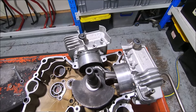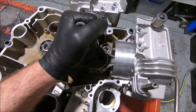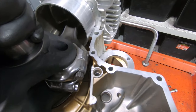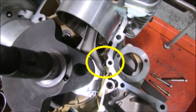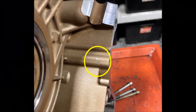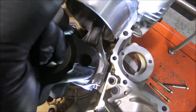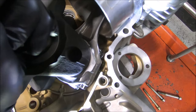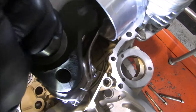What was happening was the rod bolts for the vertical cylinder were hitting the crankcase down the bottom. I've got it assembled now with one side off so you can see in there. As it came down, that rod bolt right there was just touching the cases in the bump around the bolt hole. So I put the rod bolts in the lathe and took a millimetre off the end of them. Because I always replace the rod bolts, the ones I'm using here are just junk — they're not going to be reused. With 1mm taken off the end of the rod bolts, it was fine.